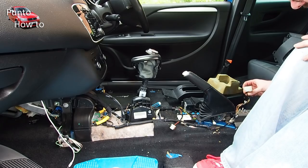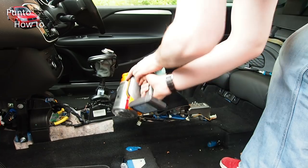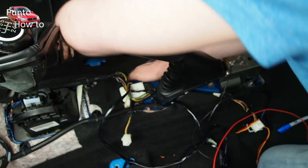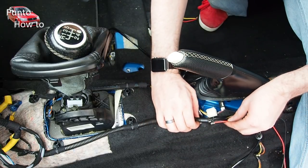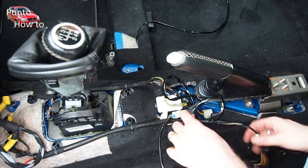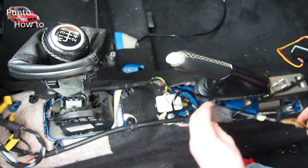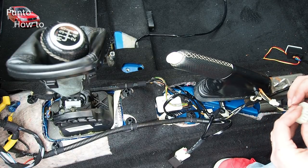And now we have a very empty looking car! This is a great opportunity to hoover the car and get rid of all the crumbs and dirt and debris that is now exposed. Now we start laying out the wiring loom for each seat. There are two plugs going to each seat. Parts of this wiring harness are quite short, so we thread them down under the carpet just beside the handbrake on either side of the centre console. There's a piece of conduit with quite a bit of space in it just on the left hand side of the gearstick, so we thread our main power and earth wires down this towards the front of the car. We get the relay in a safe position where it's not going to foul on anything else — any of the mechanisms for the handbrake or the gearstick. We then thread the wiring up towards the actual switch itself.